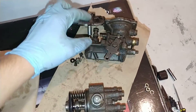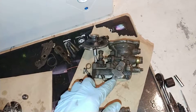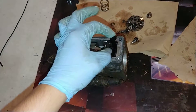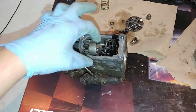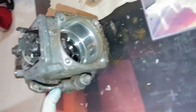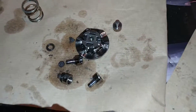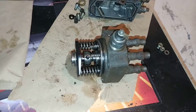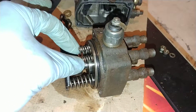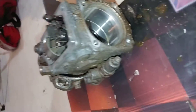We went over the top half of the pump — the boost and fueling control, fuel shutoff solenoid, fuel shutoff lever, the body of the pump, how the throttle controls work, the fuel shutoff mechanical actuator, the fly weights which try to return you to zero throttle, cold start, and the cam plate mechanism which is currently out and the reason the pump is broken. Now we'll go into the actual pumping mechanism. Since the last video I put these two little springs back in — they just kind of rest there and return you to the zero throttle position.